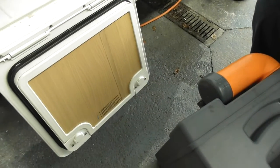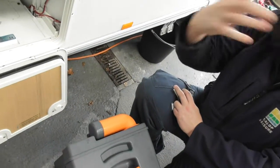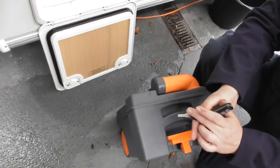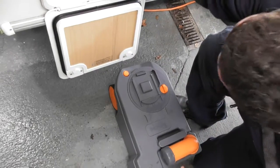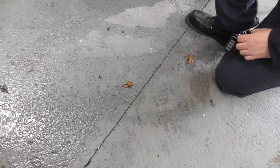I tend to use a plastic bottle - I drain mine back off into the bottle and put it back in my gas locker. Then when I next go away, all I've got to do is get the bottle out and tip it straight back in. Rather than wasting it, there's no point tipping it down the drain - you can just reuse it, and it stays pink. To lock the cassette back in, push it in and it's the bottom of the handle that locks it. Then lock pushed in, make sure it's clicked, key in, turn, and it locks the button so no one can press the button in.